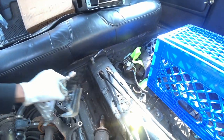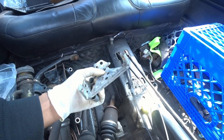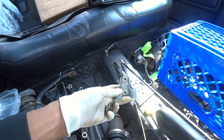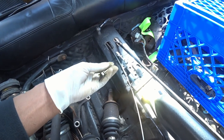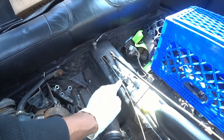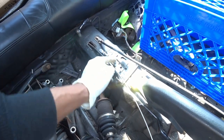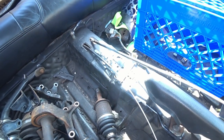So here's what we did so far: I had this bracket welded up — this is where the center console mounts, so this one bolted down right there. This is the portion that will normally hold the factory e-brake cables, so we use this to space it down, screw it into place. Then the new aftermarket cable will be cut to length right about here, and this particular portion of the cable will run through here, tying to this brass fitting, and then the e-brake will work just like that.